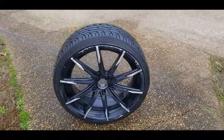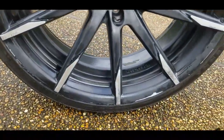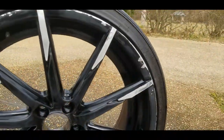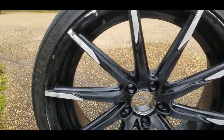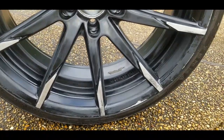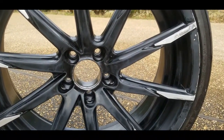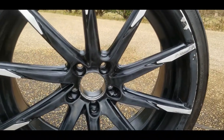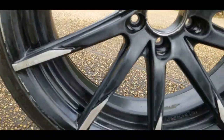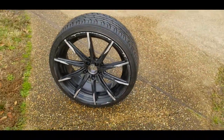All right, so here we go. This rim has been sanded, wet sanded with 320. Just washed it with some dish soap, so that should break down whatever grease or whatever is still on here. So it's been washed and dried or wiped down, so it still can stand to dry a little bit more. Still got a few wet spots on there, but you can see it's hazed up from the sanding. So once this is dry, this will be ready to paint.